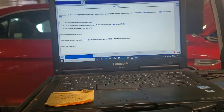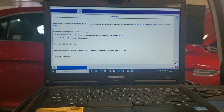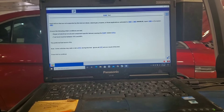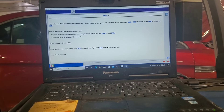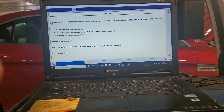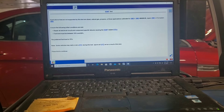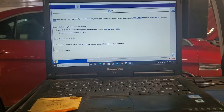I got a code for a reprogram of the BCM because of some kind of shutdown after startup. The fix for it is when using your remote start or your app there's a hiccup with the BCM that causes it to shut down. It also doesn't like the bleed-up procedure with the evap system, so I'm going to run a system evap test right now to see what's going on, and then check the brakes and go for a test drive.